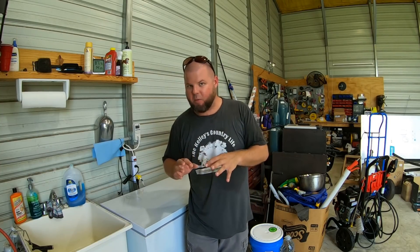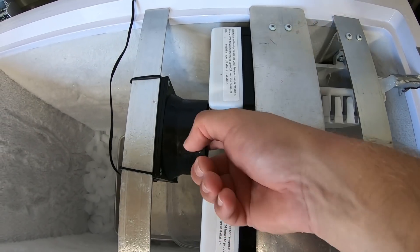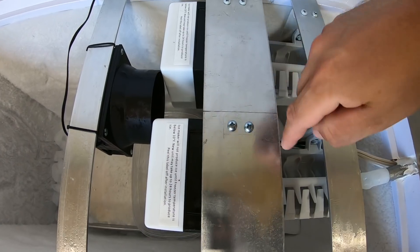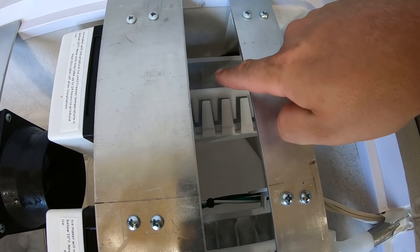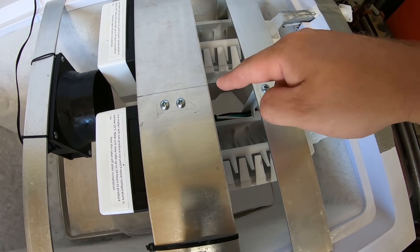Something worth noting: it looked like both ice makers had ice in them that was completely frozen and they were not far from dumping — that would easily put us in the 12 plus pound range. It's all about timing; that's why I do two days. It would be better to do three or four days and average the numbers together. Without a doubt we are seeing one heck of an increase, and why? It all has to do with velocity. I have put this forcing cone right here — it is necking down the air, increasing velocity and pushing it right through the ice makers, hitting the back wall. Not only is it hitting the underside of the ice makers, it's hitting the top. That's an important point that we really need to discuss.